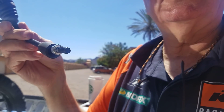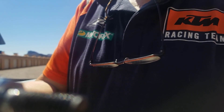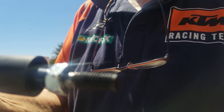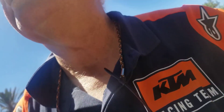As it turns out, these mirrors which I was trying to adjust — you can see where it's all galled — the mechanic who mounted this thing to ship it down to me evidently tightened it the wrong way. These are left-handed threads, and neither I nor he knew that. So when he put it in the truck and moved the mirrors out of the way for shipping, he twisted the threads off. My perfectly brand new bike isn't quite so perfect anymore.